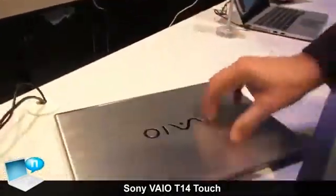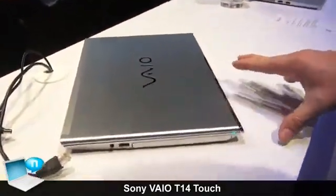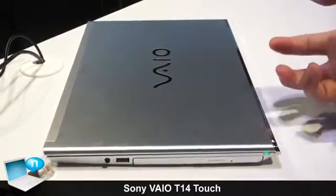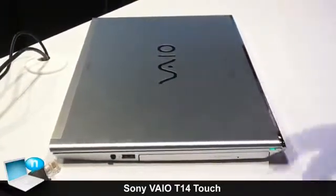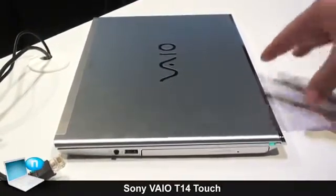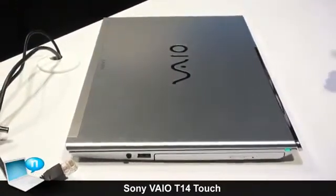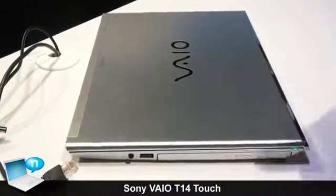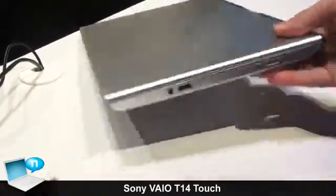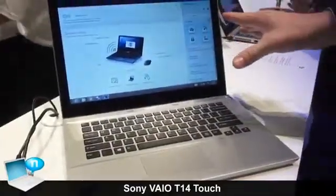Additionally, this laptop has been fitted with VAIO RapidWake technology. When you close the lid, it will go into a modified hibernation mode. It takes about 10 to 15 seconds to get into the mode, and the green power light will turn off when that's complete. All of the open applications are being saved to the solid-state drive. Once done saving, it goes into sleep mode, and by simply opening the lid, everything will be restored and it will take about two seconds until we're back up and running. You can see the power light is now off — it took about 15 seconds, but everything is saved and secure.